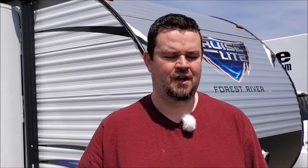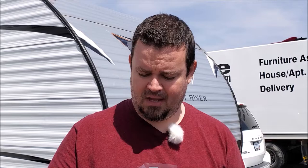We noticed late in the season last year that the power tongue jack switch — which allows the tongue of the trailer to go up and down — wasn't working properly. You had to really mash down on the button to get it to work, and sometimes it wouldn't work at all. So I went to etrailer.com — not sponsored — and picked up a new power switch. This is for a RAM electric jack; the part number is EJ3520PSW. This is the switch for the jack movement, not the light. I've never performed this repair before, but it's pretty straightforward — six blade connections and it looks like it snaps in with a couple of retaining clips.